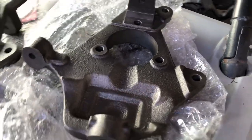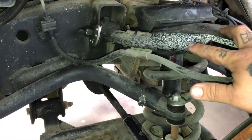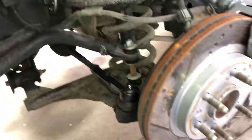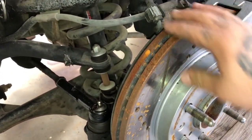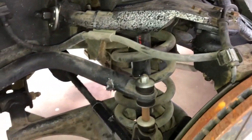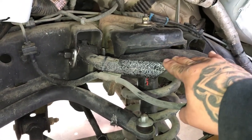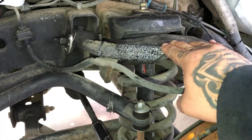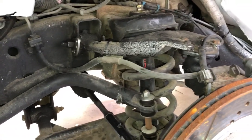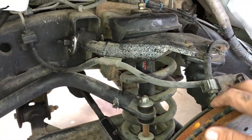I'm going to take you guys to my truck to see if they match. Here we got the lowers and uppers - you can see it has the same kind of finish to it. Although you won't be able to see the spindle from back there because the rotor's in the way. These control arms are also DJM - they're needed when you go five or six inches or more in the front. I haven't gotten the truck aligned yet because I knew I was going to go lower in the front, so there was no need to spend money and then have to take it to get realigned after the spindle drop. Now we're going to do it all together.